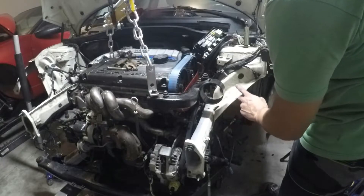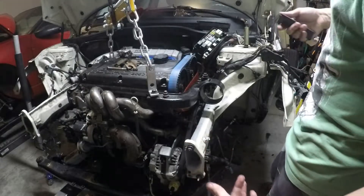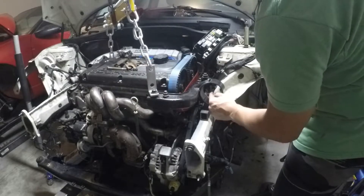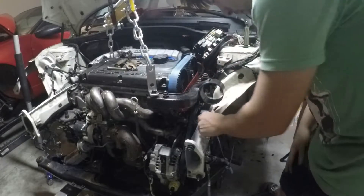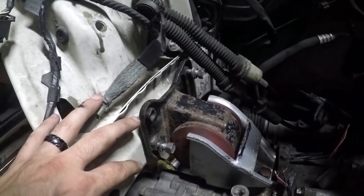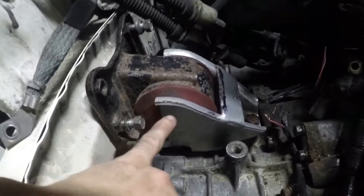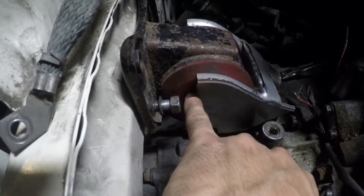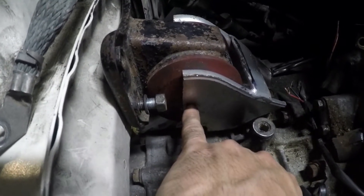I'll end up chopping this right here and then it will be able to clear the headlight — which is the reason why it doesn't fit right now — because to keep it stealth and keep it a sleeper, I have to have headlights. Since this will be cut off here, I'm going to relocate the hole to the new center, which is going to be just above the frame rail so there won't be any twisting load on this.